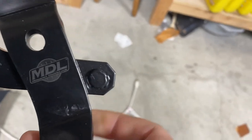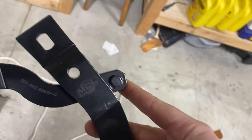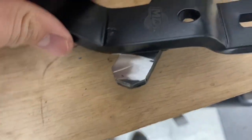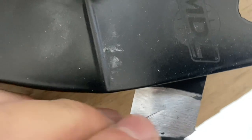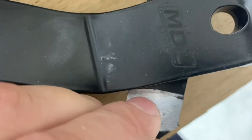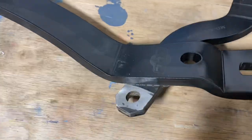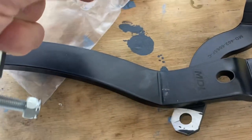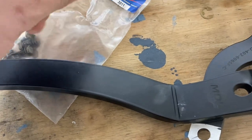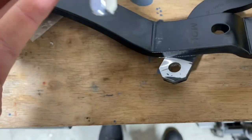Here's a nice brand new pedal, all painted — even says Modern Driveline on it. This piece you've got to grind off right off the bat. Now that you've ground it off, take a punch or an air chisel and knock that out. That's what it looks like when it's done. Go ahead and take one of your little clevises and make sure it slides through — it does. So we're all good.